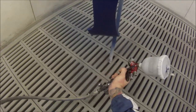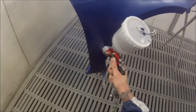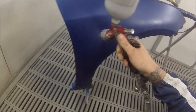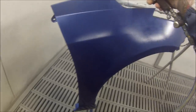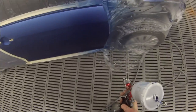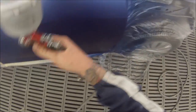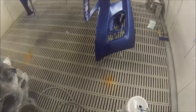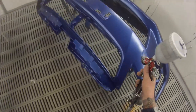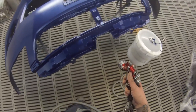It's starting to get covered already — this is only my first coat of proper colour and it's visually already covered. You'd probably find that if you put it outside it would look slightly different because you'd be seeing through the top colour to the bottom colour. We'll put another couple of coats on just to make sure it's 100% covered. By the time I'd put my coat on the other panels, the door is already ready for me to go back to. I'll give this bumper bar a couple more minutes to flash down a bit, but it's already starting to dull down.